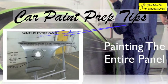But let's take this fender that we had a dent in. We finished the body work with 150 grit, and that's the first little circle. Now you may have to use your imagination here with my graphics, but the first little circle is 150 grit. The next thing we're going to do is feather edge each layer of paint out at least 1/4 of an inch, where you can see those layers, and that's the next few rings in there, where it's layered out. And then we're going to do that with 220 grit.